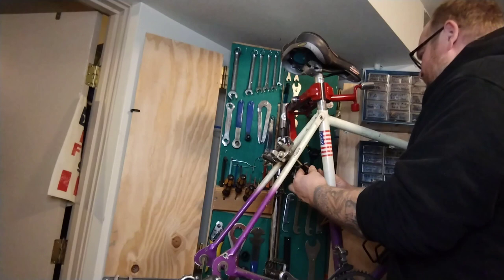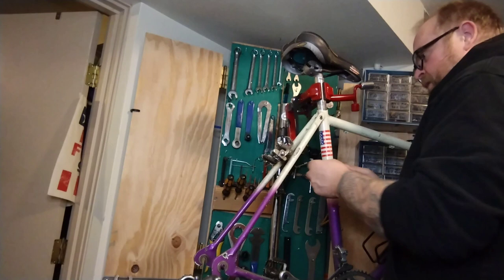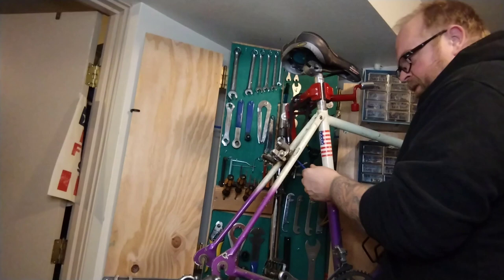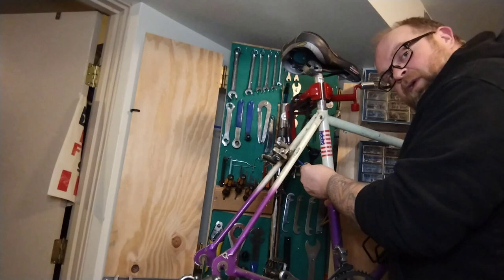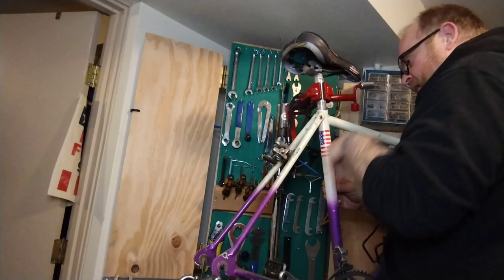You can see this one has a weird fender mount with some tight weird fenders that have to clip in between the frame and the brake. On the nutted ones, you can clip it on the front, you can clip it on the back, you can add it onto the back of the brake and add another nut, so you don't have to mess with the brake adjustment while trying to tighten your fenders down, get your brakes all crooked, trying to have your brakes even on the rim and your fender even around your tire and not rub on one side. It's always a challenge.